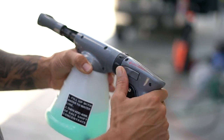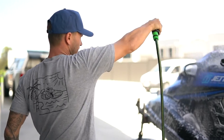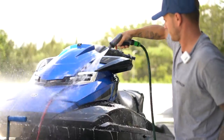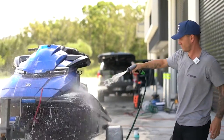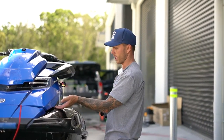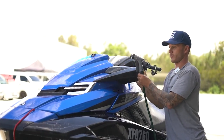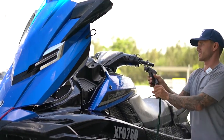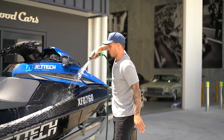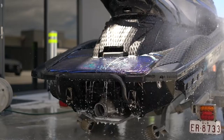Simply unclick the trigger and hose it down — same process, start up high and work your way down. Jet skis trap a lot of salt and soap in the edges, so make sure you work through all the crevices. Sometimes I like to lift the bonnet and give it a quick rinse underneath. With the ski chocked up, I also run the hose down the foot well, which allows all the water and soap to run down to the back of the ski.